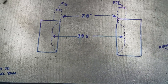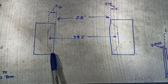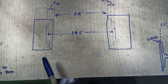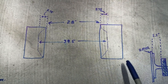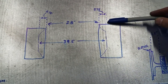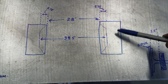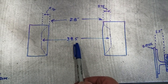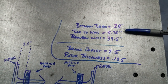Just a quick couple of cartoonish sketches here — these two represent your rear tires. These dashed lines represent the offset from the back surface of the wheel to the bulge of the tire. In between the bulges of the tire, the sidewall of the tire is about 28 inches. These particular wheels give us a 5.75 inch offset from the inside wall of the tire to the actual wheel mounting surface, so adding one on each side gives us an overall width in between the wheels of 39.5 inches.